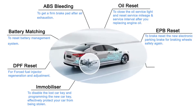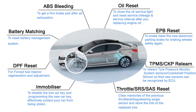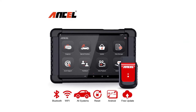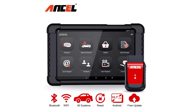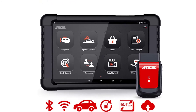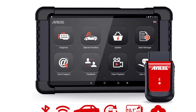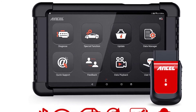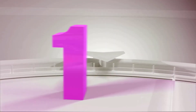SAS reset helps clear the fault steering angle sensor memory and plays an important role in the steering circuit. Battery reset registers the battery replacement and activates the rest state of the vehicle battery system. CVT reset: on CVT transmissions, the timing of the release and application of clutch packs and bands is controlled by the transmission control module. TPMS reset makes TPMS sensor display sensor IDs from the vehicle's ECU, allowing for sensor replacement ID input and sensor testing. IMMO keys service reads pin codes from the vehicle security system, mainly used to disable lost vehicle keys and program a new replacement key fob. DPF regeneration reset specially works for diesel particulate filter systems.